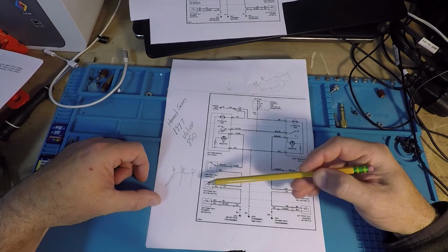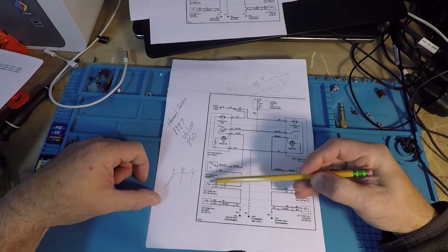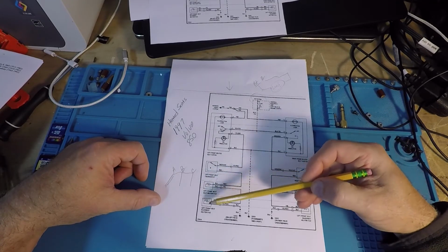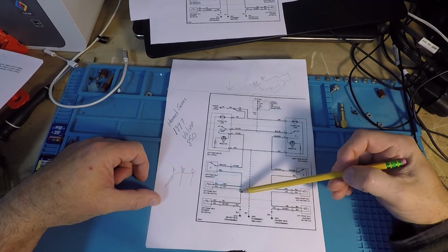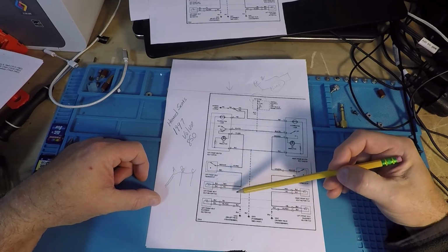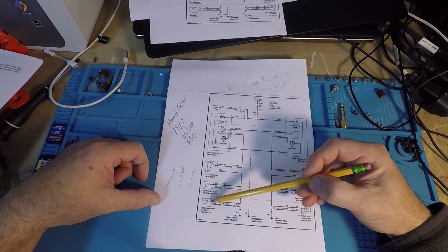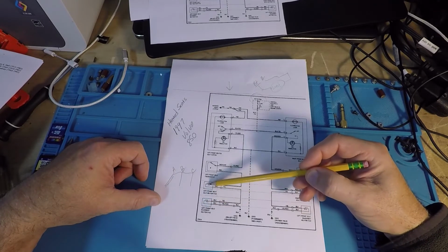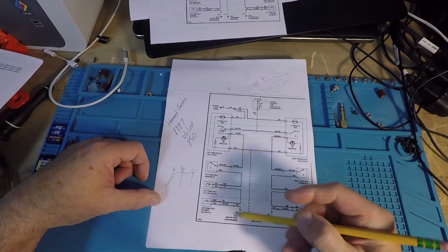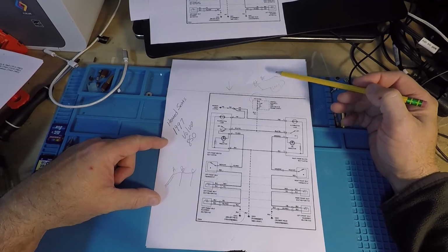If this one burns out, well, the current is going to come here into the grid, not make its way through, and just stop. If this one is bad, then the seat backrest will never get its current. So it has to flow through the lower seat, come out via this yellow wire, go in the yellow wire to the seat back, go through the resistive grid, which is very similar to what's on the bottom, and flow out in order to get to ground. In other words, go back to this. Anytime you get confused, here it is.